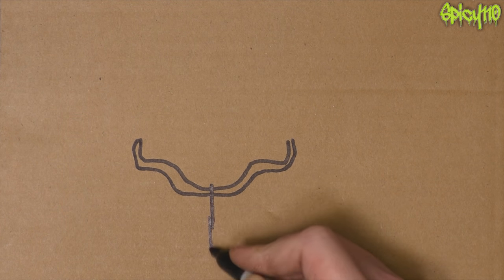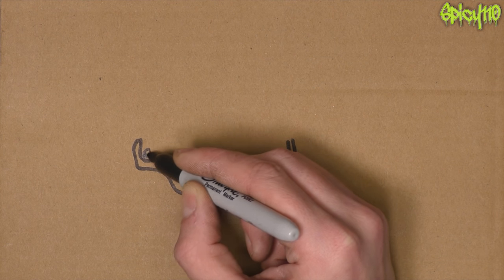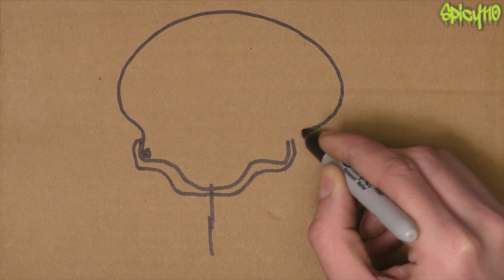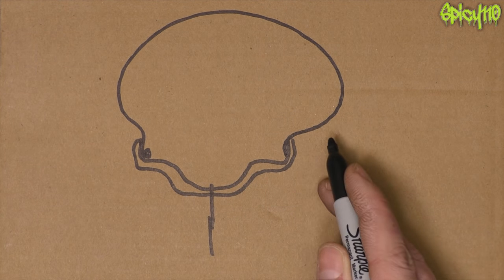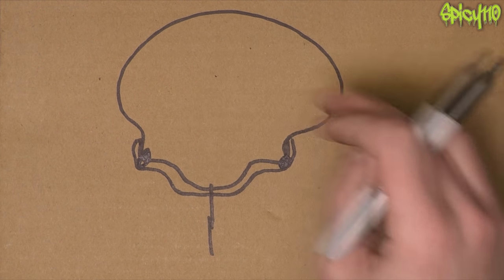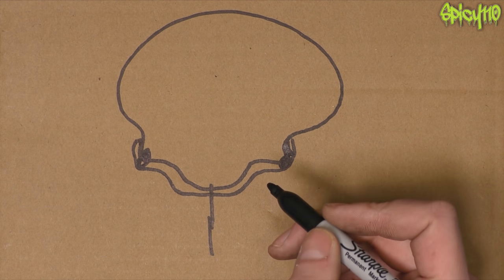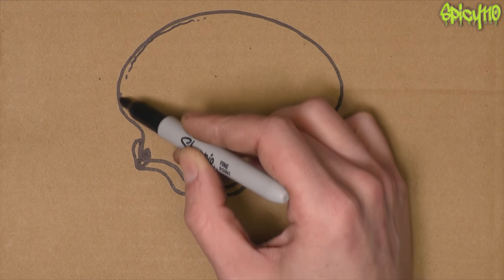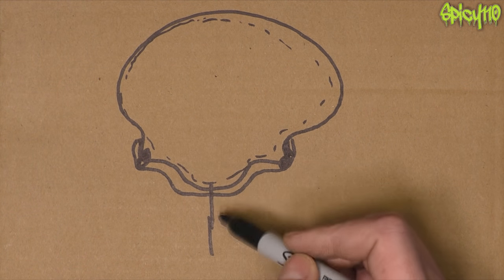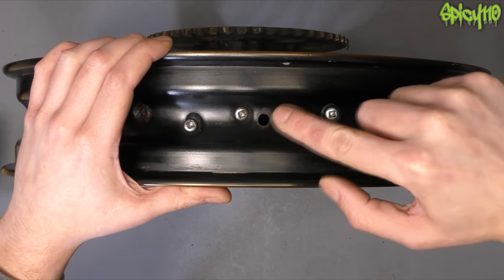So this is the rim like so, with spokes coming through. Your motorcycle tyre has a thing called a bead - the edge of the tyre which has a metal strand in it - which lives down in the corner, and the tyre comes up and out here. This bead locks into the outside of the rim, and when there's air pressure inside it pushes into the rim, giving you your air seal. If you have a cast rim, you just fill this capacity with air - that is your tubeless tyre, because the air can't get out; there are no holes, it's all sealed by the beads.